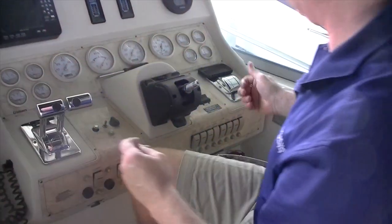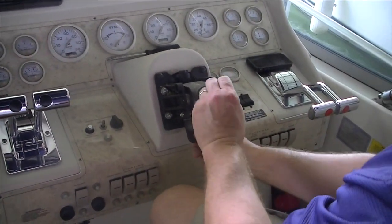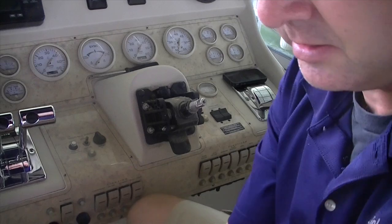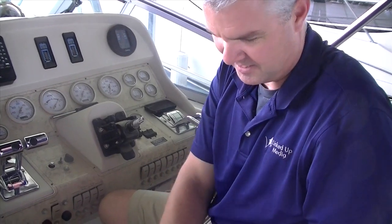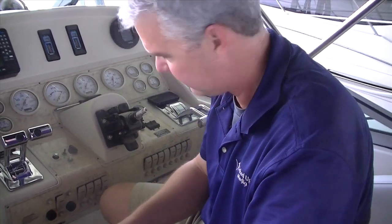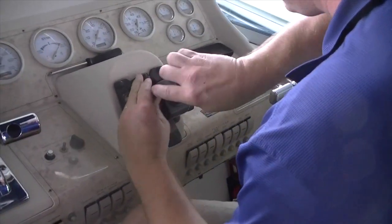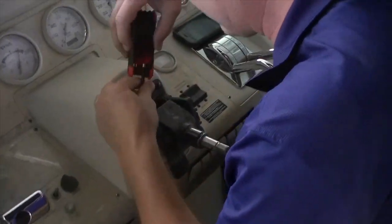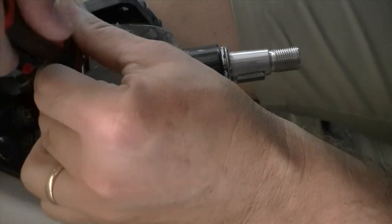Once you pull this thing off, you start disassembling a little bit at a time by pulling that piece off. My screw is broken off on here so this piece comes off really easily — it just pops off like that. That leaves us with the tilt mechanism, and the seal we're trying to get to is back in here. We've got to take off these four little nuts right here, and then there's a 5/32 allen screw back here that holds the universal joint onto the pump shaft.